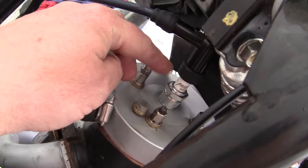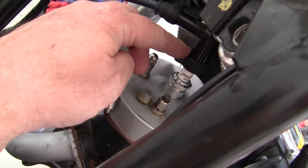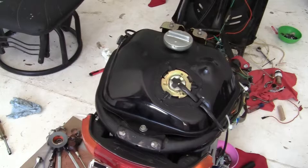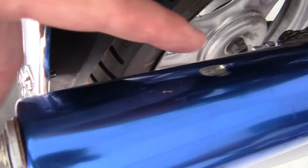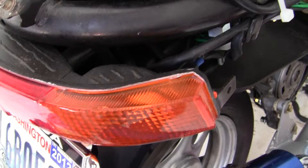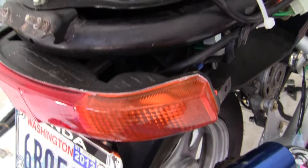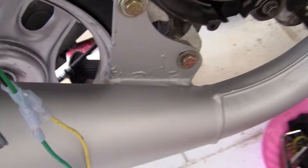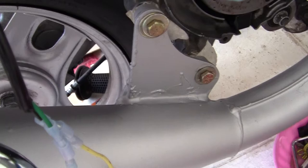The SR8 shock extender is going to be brilliant for what I want — it's going to give me more room up here for the spark plug, and so the muffler won't hit. Before you can see that this area and this area were hitting right here when I would go over a heavy bump. What that would do is first of all it loosened the clamp right here, and I lost it. The second thing it did was it stressed the pipe and I believe it cracked it.